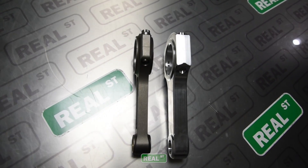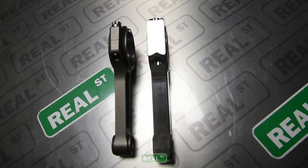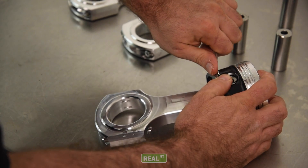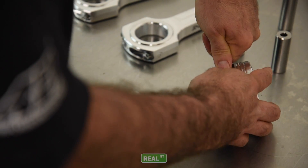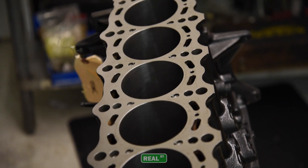Because the rod is physically larger than the steel rod, it's going to add some steps you'll have to follow during assembly. You're going to want to check clearance between the small end of the rod and the piston pin piers. You're also going to want to check clearance between the rod and the block at the base of the cylinders and around any girdle. Run the rod through its motion — you can use aluminum 60-thousandths welding wire and pinch it in areas you can't see with your eyes to confirm clearance.